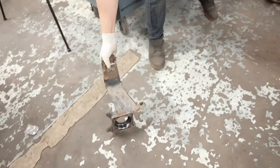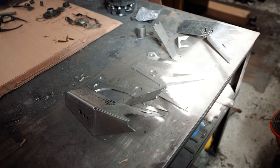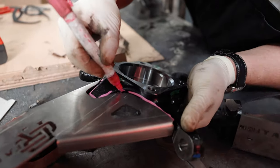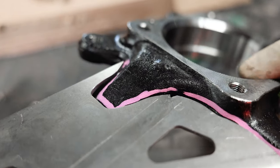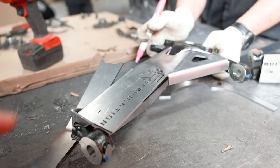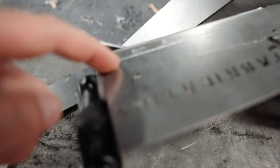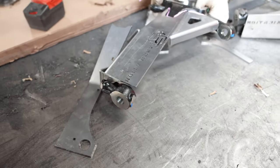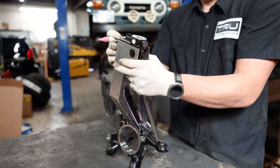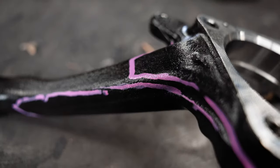There's the old gusset, and we've got some new ones — Toyota OEM spindles right there with the new gussets. Joel is marking where he needs to grind the spindle down to bare steel so he can make sure he's got a clean surface to weld the new gussets to the spindle. We've got the spindle put together and we'll show you the process of getting everything lined up with the locking pins. Now that Joel has everything marked, we're going to get a grinder and get this down to bare metal.